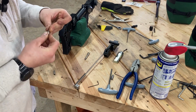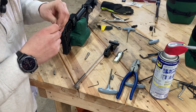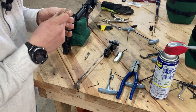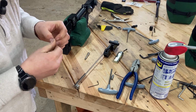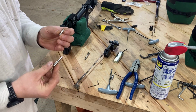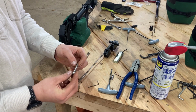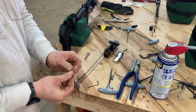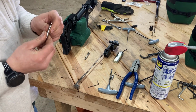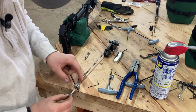Let's see what kind of room we have for this O-ring here. Yep, just one O-ring will go on there. I'm going to use a 25 caliber liner. It's chamfered at both ends, so I can't actually tell the difference of which side should go where. It's tight. Okay. Let's go into the block just like this.